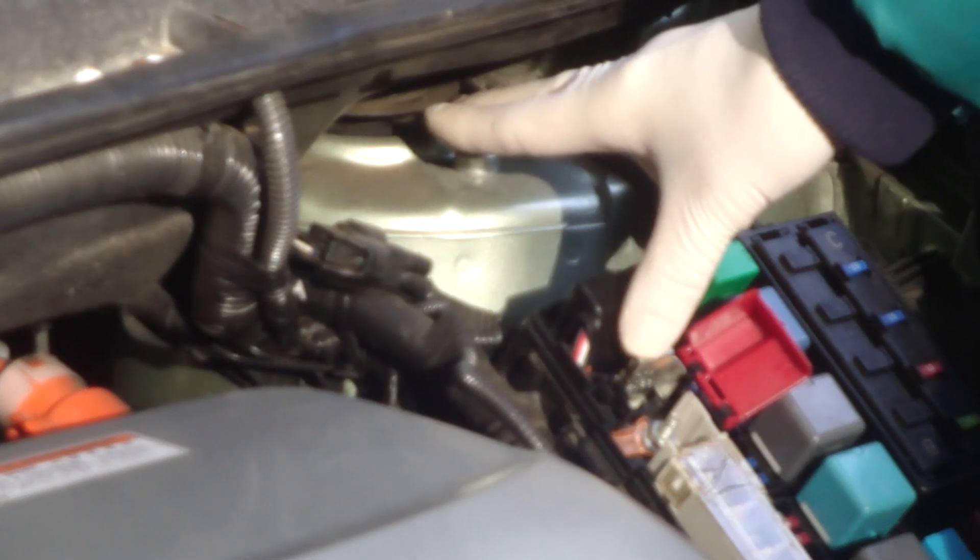Attach the negative jumper from the jumper battery to that, and that way you'll be able to jumpstart the car. Some people try to charge their battery through here because this has a connection to the 12-volt battery, but I do not recommend doing that. I would charge the battery directly on the battery, because the owner's manual specifically states to disconnect the negative terminal of the battery when charging. If you don't disconnect it, you may damage electrical components. So let's go over and I'll show you how to open up the hatch on the car with a dead battery.